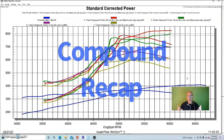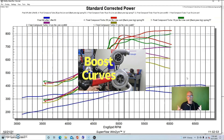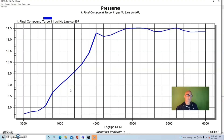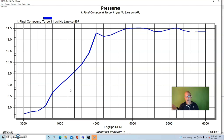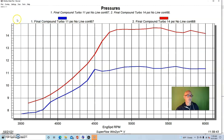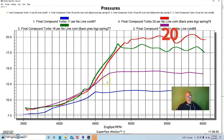Let's take a look at the boost curves from the compound setup and then compare to conventional turbocharging on the same motor. The compound setup shows a rising boost curve from 3,500 up to 4,500 RPM, then maintains fairly flat. We used an electronic boost controller, so the top of the curve was held at a consistent 11.5 pounds — but it didn't spool to that level until 3,500 to 4,500 RPM. When we raised the boost to 14, 18, and then 20 pounds, the curve shape was fairly consistent, just rising to the new desired level controlled by the wastegate controller.